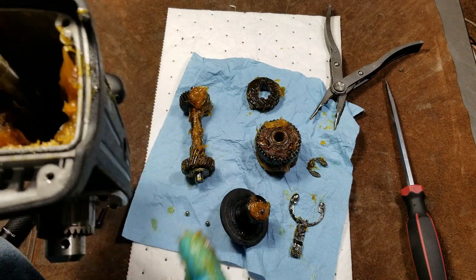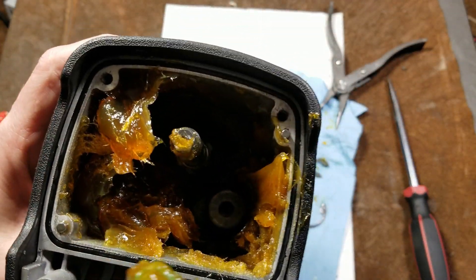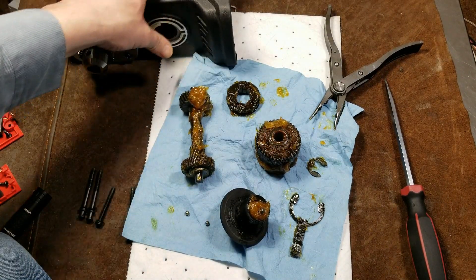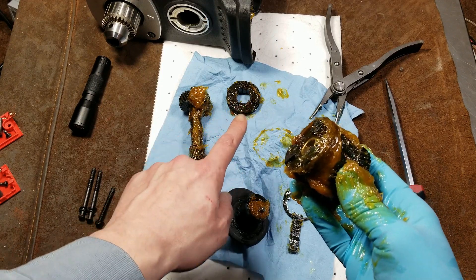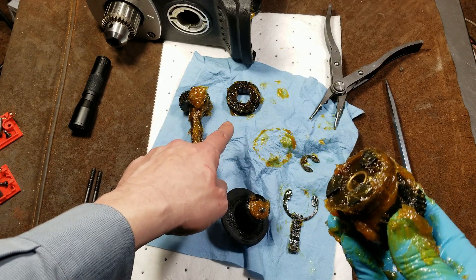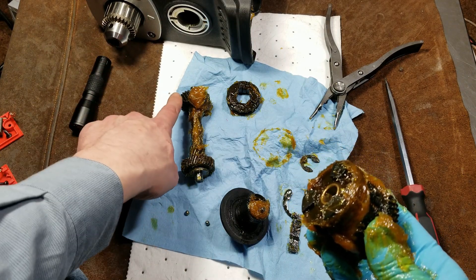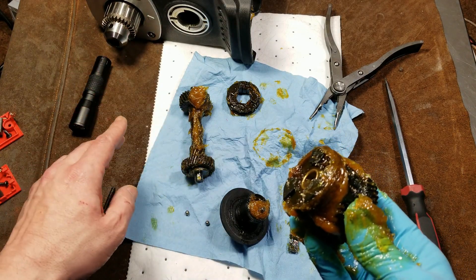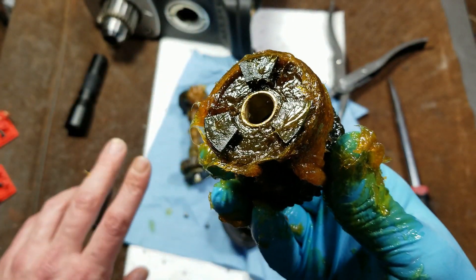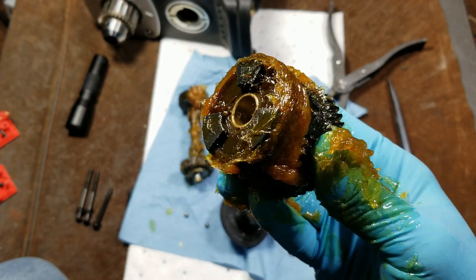This dog — which is first and second gear — interacts with a gear down in the bottom. The reverse lever slides this collar back and forth, and it has dog teeth on both sides. They either engage with the small gear in the back — which the bigger gear turns, making it spin faster — or slide forward to engage the dog teeth in the back of the clutch. That's why the clutch only works in first gear: it's entirely bypassed when you're in second gear.